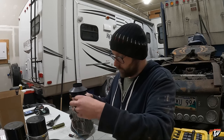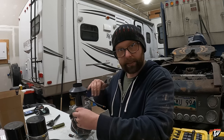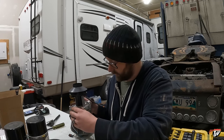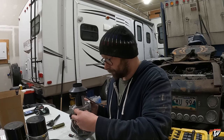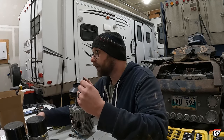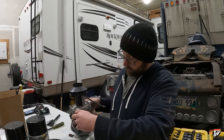And then it's just a few screws. You take off the blower motor, replace the gasket. Make sure you go on Amazon or something, get a, for me, it was an Airtronic D2 rebuild kit. This was sent to me by a friend, by Jim. Thanks, Jim. I really do appreciate you sending this rebuild kit to me with all the gaskets and everything that I need. And you take that all apart, you take the burner out.